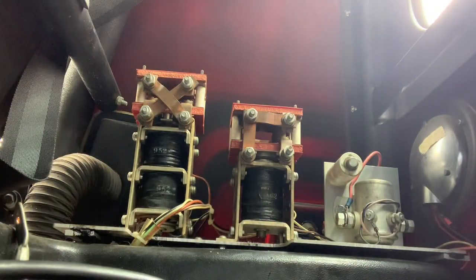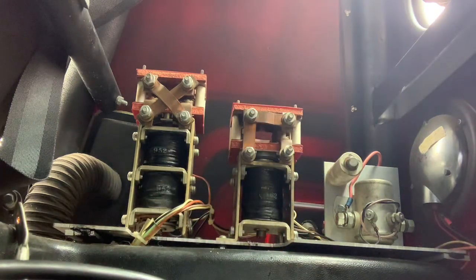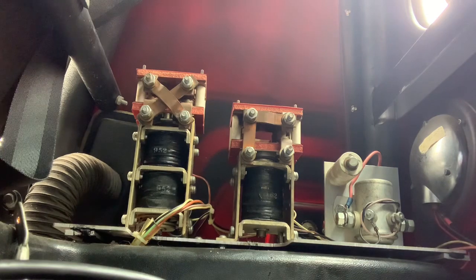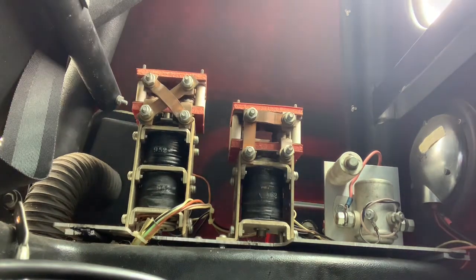What I want to see is if the contactors are still set up and still wired to the 12-volt system. I want to turn the key, listen to see if the contactors switch on, and try to activate them with the accelerator pedal — even though I don't have the main batteries in the car. I want to see if I can turn it over.